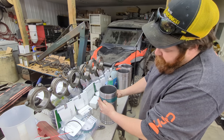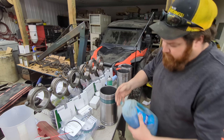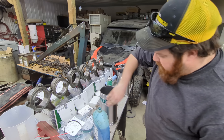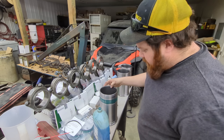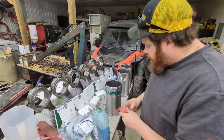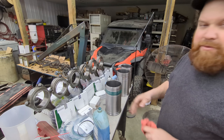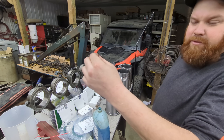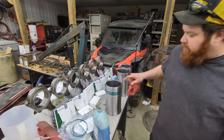These bottom green O-rings get seated into position. We'll get this started in the block, and then the O-rings will hold it up a little bit, and then we'll get this ring with engine oil put on there. Then with the tool we'll push them down in the block — we'll show you how to do that.